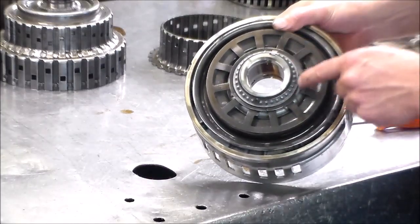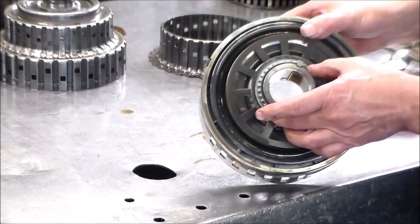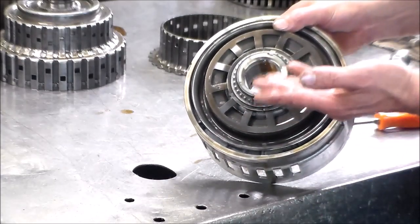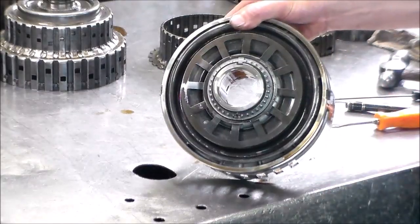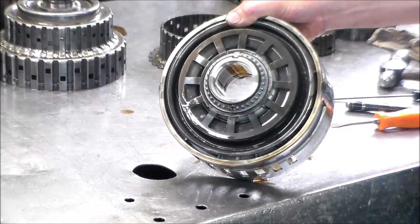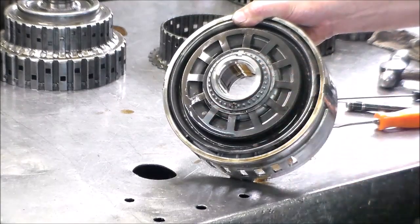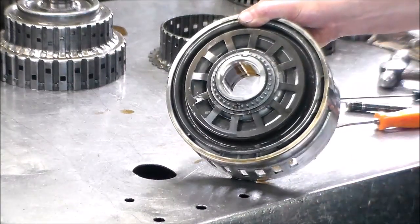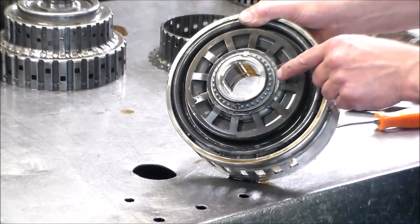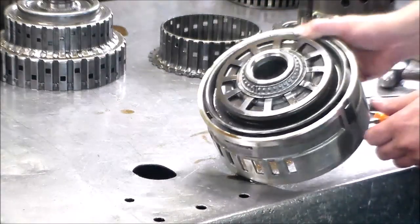on how this goes. You have the split ring here holding the piston in, and then you have another split ring up here, pretty much holding the center piston in, so it can't come up that high, and only come up so high. This setup's a little tricky, so you just gotta really look and see how it goes together before you take it apart. Because you got the piston here, you got the bellows return spring, and you got another one here. Two split rings. So pretty much you gotta take this one off first. All right, the big split ring, and then you'll be able to push this little piston down, and get this ring out, and then you can take everything apart.